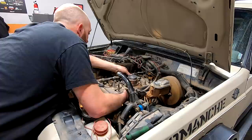So remember that whole thing I said about how this header fits perfectly right out of the box, and it was kind of rare for aftermarket parts, and I was so happy that it actually fit? Well, forget everything I said, because it actually didn't fit that good at all. It bolted up to the cylinder head no problem, all the fasteners fit. So the flange was fine, but the major problem was the interference on primary number 6 and the intake manifold.